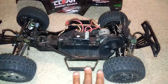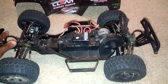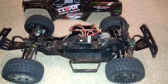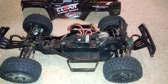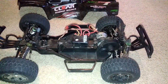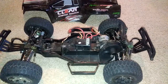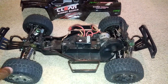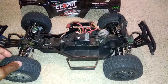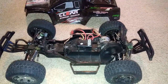I do plan on trying a higher-rated 2S lipo in here as well. After I do those upgrades I'll post running videos and let you know the total cost. Most people have radios lying around, but if not you can find one for about $20 to $25. If you invest that and another $20 on the ESC, you're looking at probably about $140 to $150 total. It's fine like it is, but as I explained, when going into a corner sharply you have to hit the brakes to cut throttle current and get a sharper turn.